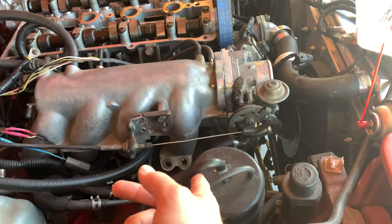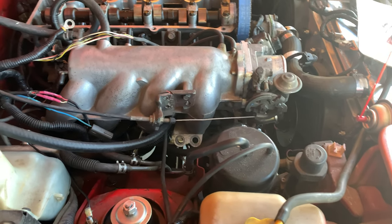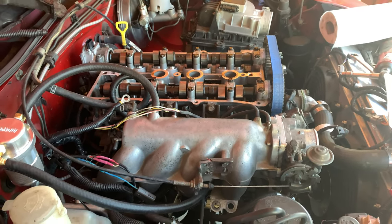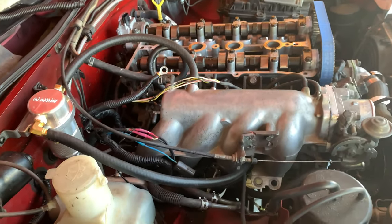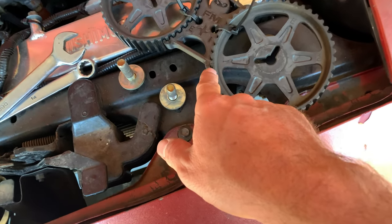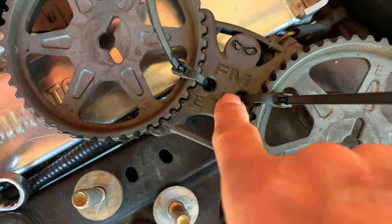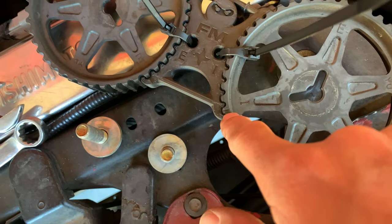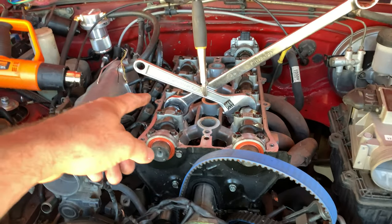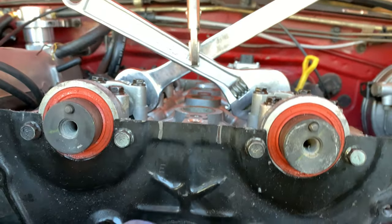While I was diagnosing that, I broke the vacuum connection to the charcoal canister — because that's a thing that happens to me. So I have three things to fix including this oil leak, but I am very confident I have found the problem. The Flying Miata cam gear tool — I call it the Cam Ninja — helped me confirm that the timing was in fact on, so I did not have to make any adjustments. I just slipped this in here and the timing marks lined up just fine, so I went ahead and zip-tied that together.